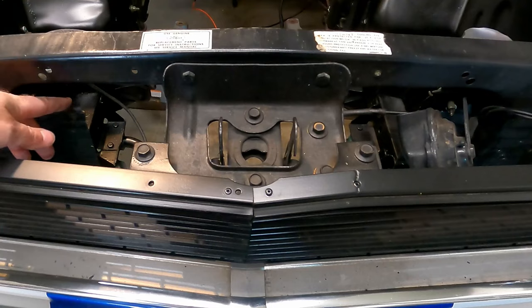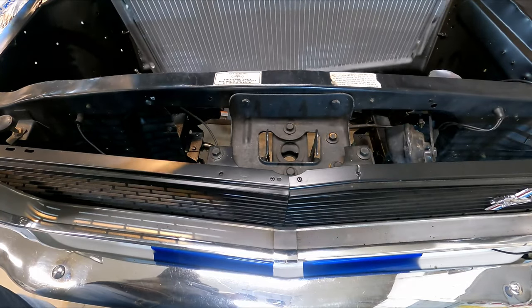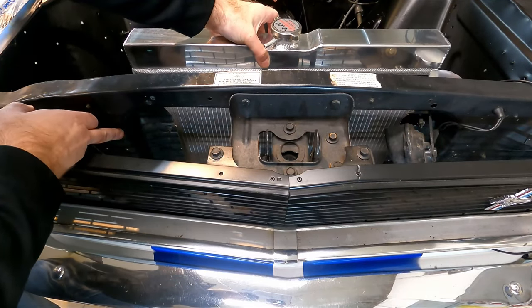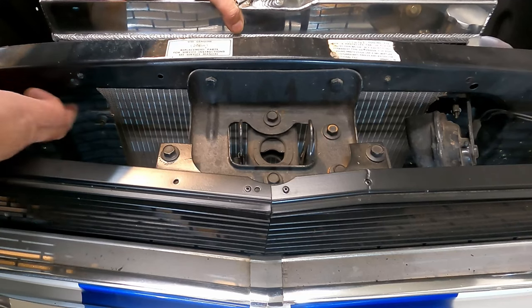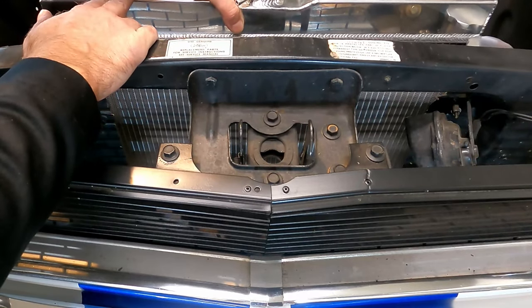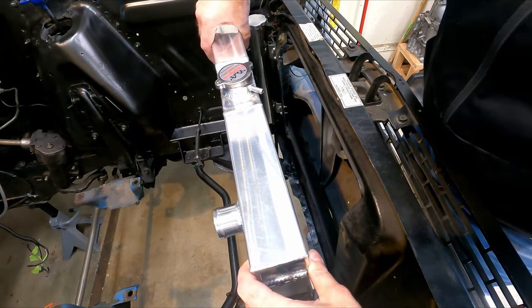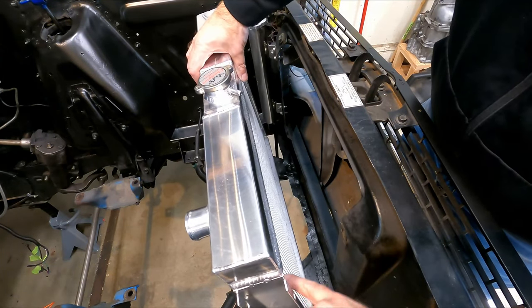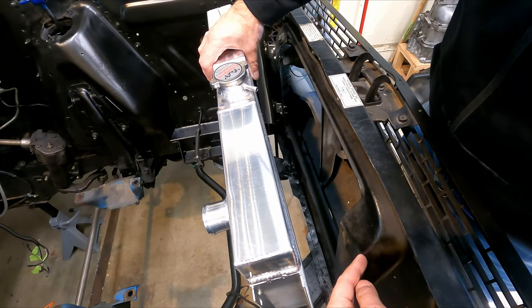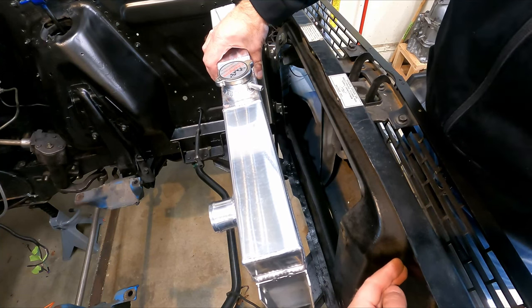You can see the opening here in the core support from the front of the car — it goes from here to here, and that's not enough. If we try to drop in a 24-inch radiator, you can already see it's a much larger system than the cutout. We're gonna have to go all the way to the edge of this formed area on both sides. The end of the radiator is right in line with this stamped part on the core support, so I'm gonna cut right up to this edge and we may cut all the way to the front if we need to.